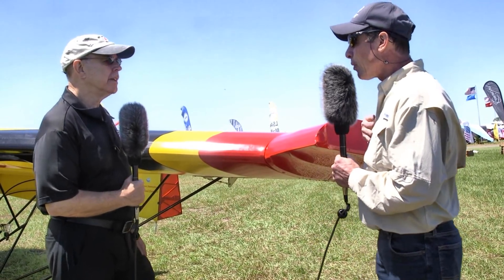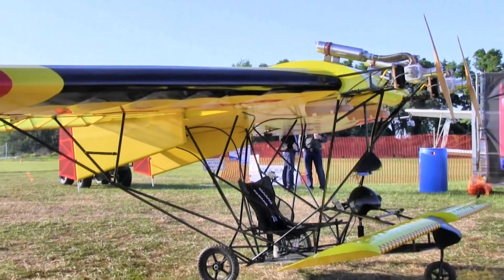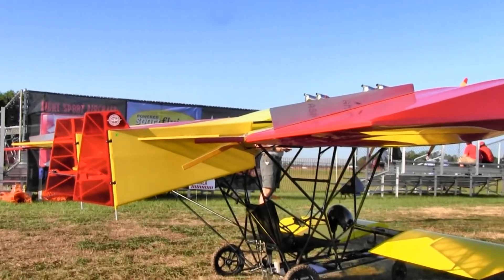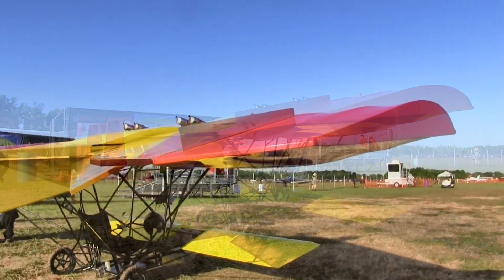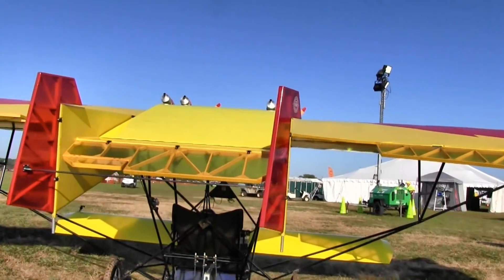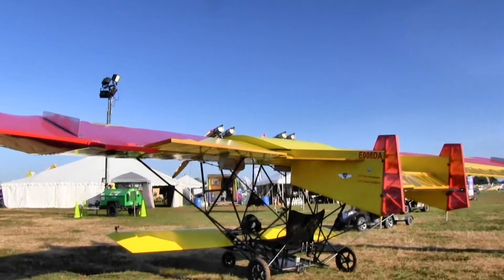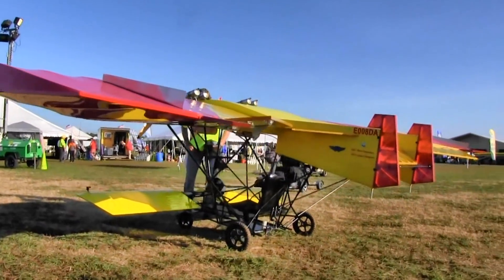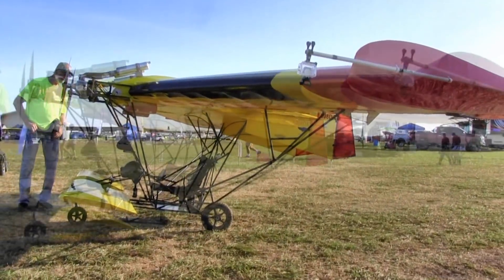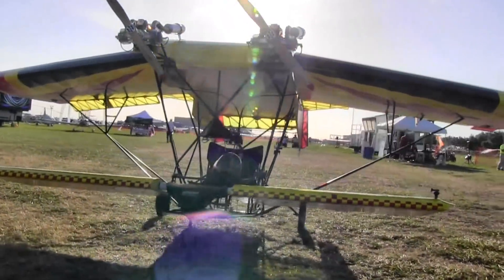I'm really not an ultralight guy, but when I read the rules that said you could go 55 knots - 63 miles an hour - I tried to design around that and got real close with the original wing design. I used my iPhone as an indicator and got 60-something miles an hour. But realistically I just put around the backyard, so by adding a little bit of wing I can slow the airplane down. It makes a 20-pound difference for a guy that weighs 190 pounds instead of 170, and I can fly a little slower and pull the engines back a bit more to cruise.